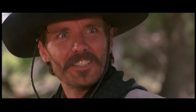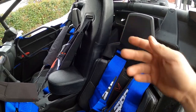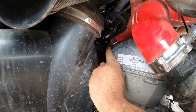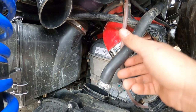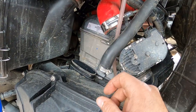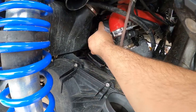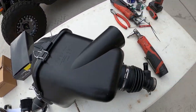Because CJ's X3 has the bump seat it's kind of hard to get the cover off, so we decided to route it through the side. We already capped off the intake box coupler — that coupler normally has this hose hooked up to it. The blow-by gases normally go through that hose and get recycled through the intake. We're rerouting this hose to go to the catch can mounted in the corner instead of getting re-burned by the engine.